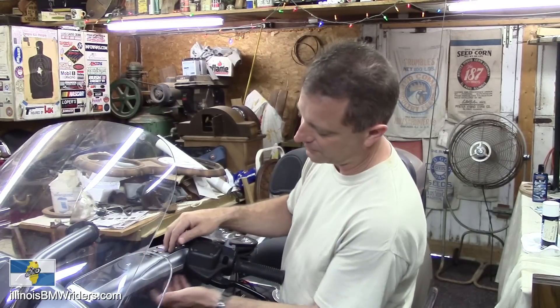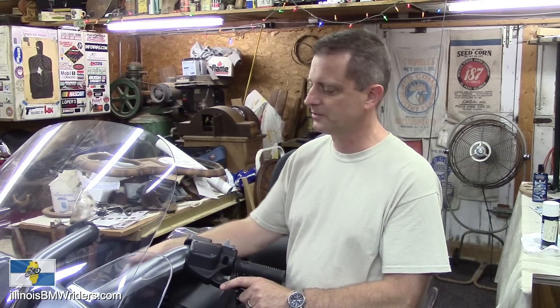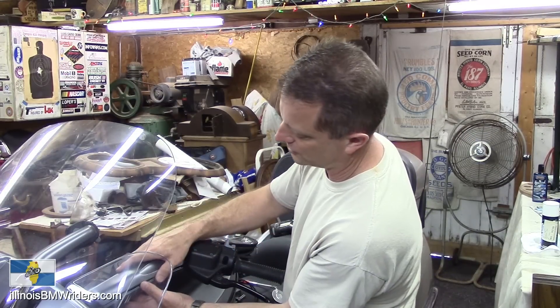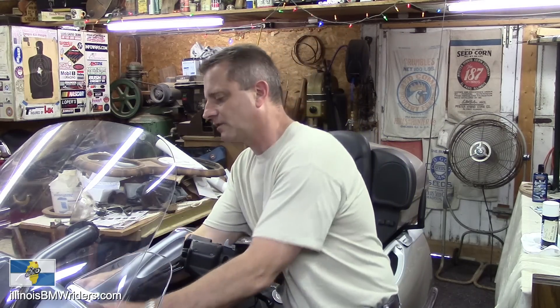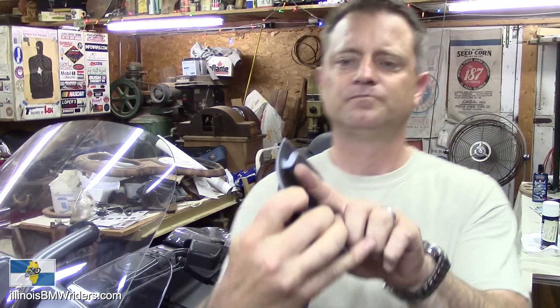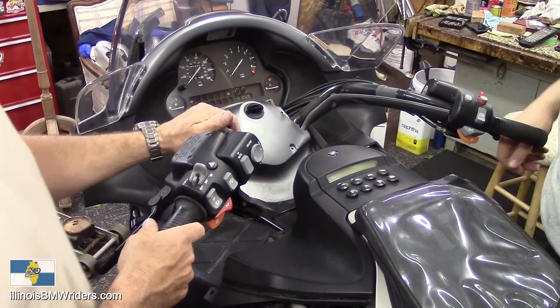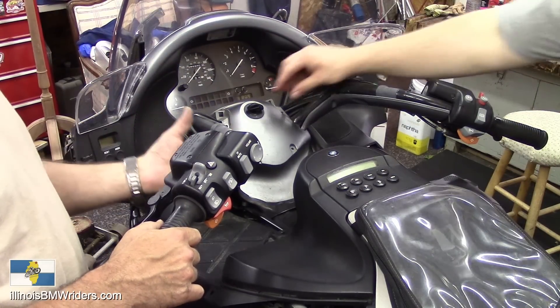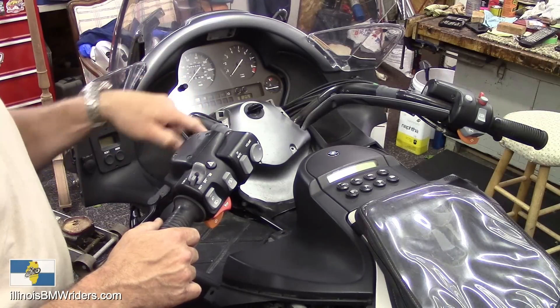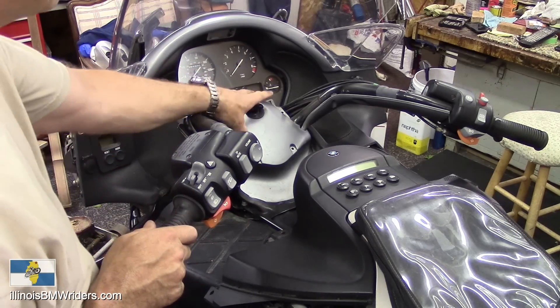You just have to remove the covers on the handlebars. There are two screws underneath here of different lengths, so take note of which one goes where — the longer one goes in the back position, the short one goes toward the front. They simply come apart like a clam. There's also a little slider up at the top — make sure you don't break that off. Pull it backwards when you lift it up and it just comes off. Pull off these bottom pieces as well; the mounting is inside and they're just attached in two places, then the bottom plastic will fall away.